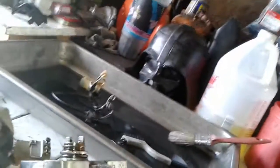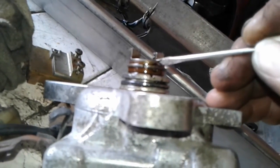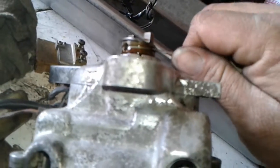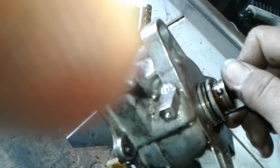I got a pocket screwdriver — you can see the cut of the clip right there. Stick the pocket screwdriver into the hole, hook the clip, and work it all the way around until the clip just comes off. Then to push the rod out, you can use one of your long screws, stick it in there, push the selector out, grab it, and pull it out.